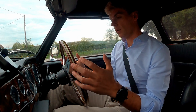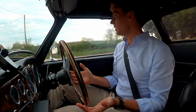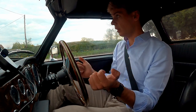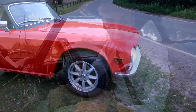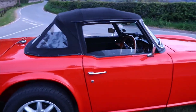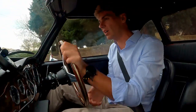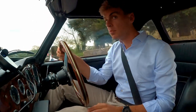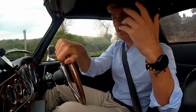The normal steering wheel would have been a leather-bound smaller diameter wheel, which I'm actually thinking of changing because I'm tall — this gives me more space to maneuver the wheel around my knees, especially when driving spiritedly. With a bigger diameter there's more steering torque at low speeds. I've got slightly stickier, wider rubber than stock — Yokohamas on front and rear. At low speeds with no power steering it's a bit of a muscle to move the car around, and parking is a bit clunky.